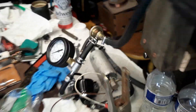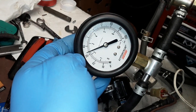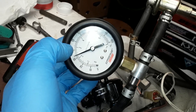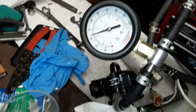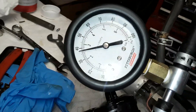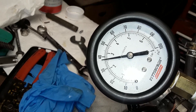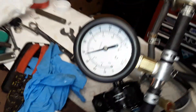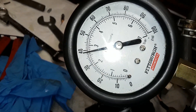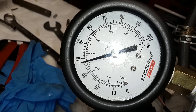I just did some tests here using a battery with 12 volts. I was testing to see if it's going to be holding pressure, and also where it releases pressure. If I tap the negative side to the negative side of the battery, I get fuel pressure — and it releases the fuel pressure right at about 37 to 38 PSI. It relaxes at about 38, so it's right at the high side.